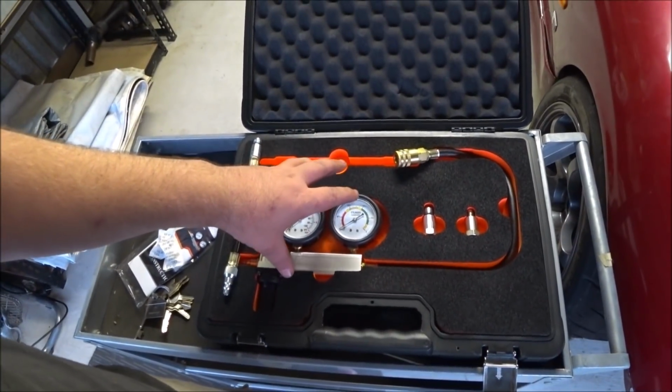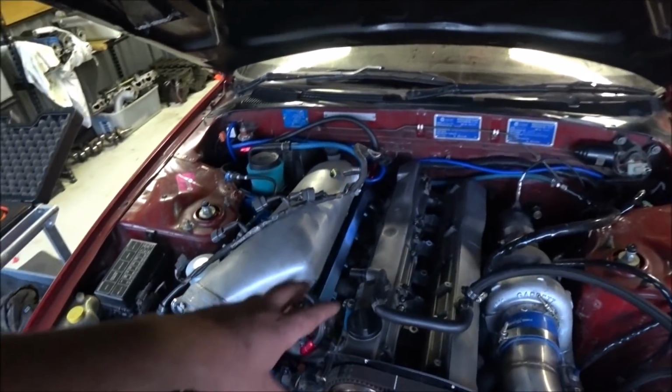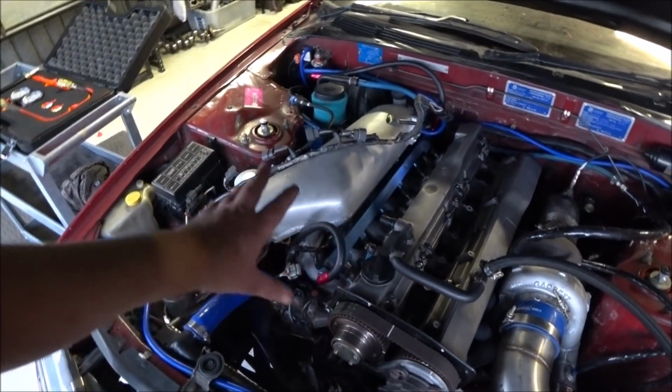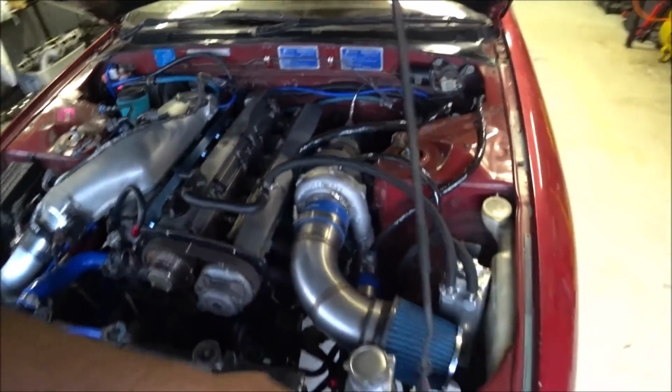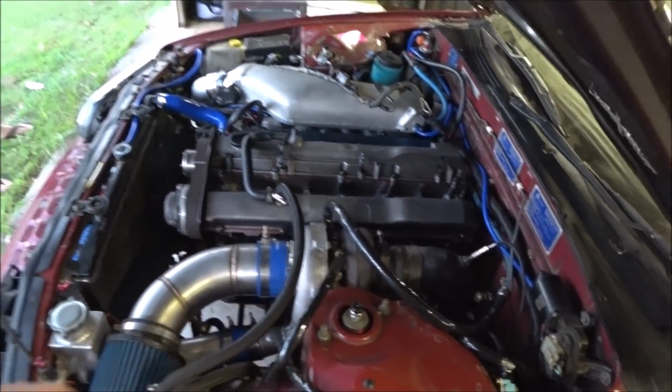So we just need to get this over here. Basically all I'm using it as a diagnostic tool for this is to tell me where the air is going, and I'll just be able to listen to where the air is going. I'll just take this off. The exhaust is not fully plumbed in. There is the two. No, it is, because the wastegates will be shut. Anyway, I should be able to hear. I should be able to determine which way the air is escaping with a continuous feed of air at 100 psi. You right? All good. So let's get the air over here and we'll get started.